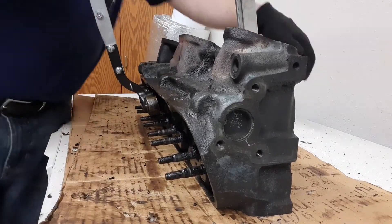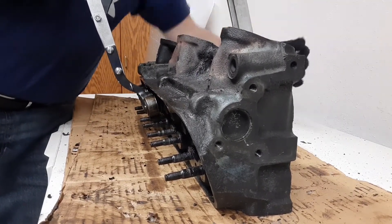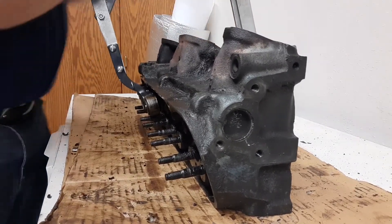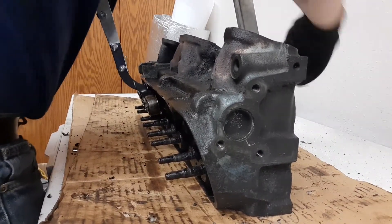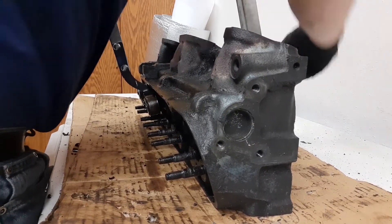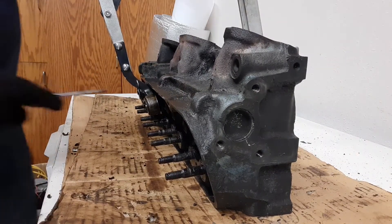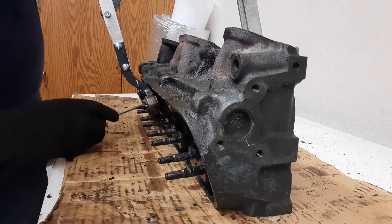It was pretty good at lower RPMs, but once I got over about 3,200 RPM, or if I hammered down on it really hard, oh my gosh — I could really blow some smoke out the exhaust. And it was all from the valve guides being shot. You can see it in the carbon buildup in the head — you can see where oil was just flying right out.